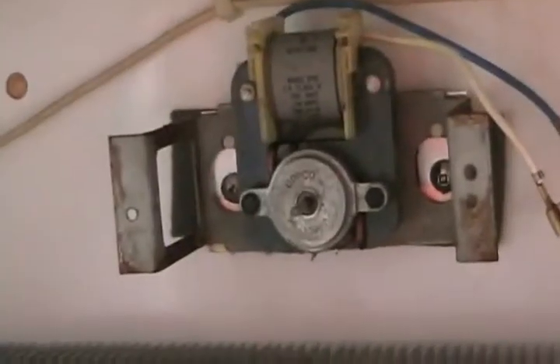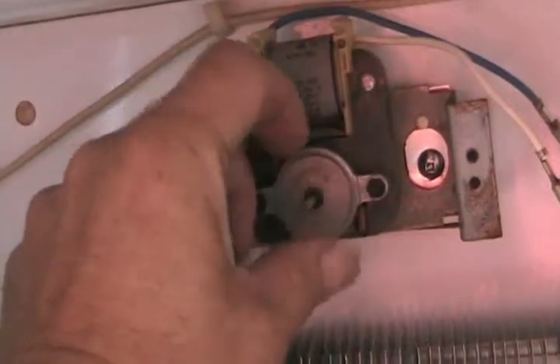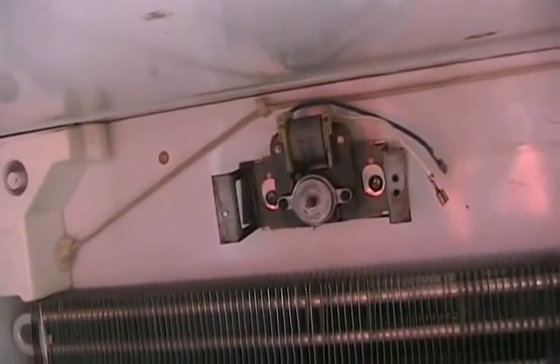Some modern fridges have a really stupid fan motor that doesn't last very long — they're called the high-efficiency DC low-heat motor. Those motors are all white and encased in plastic so you can't see any metal parts, just two wires coming out. They're DC and electronically controlled by transistors, and when they burn out they're usually just jiggling a little bit and barely twitching, or run very slow. It's a very good idea to not buy one of those to replace it — they're very expensive. Put a universal one in and make it fit.